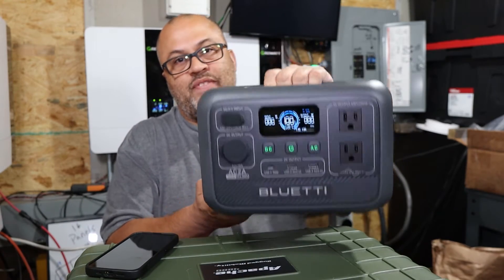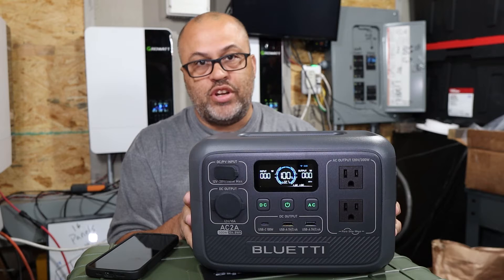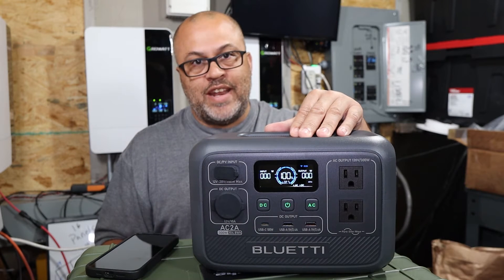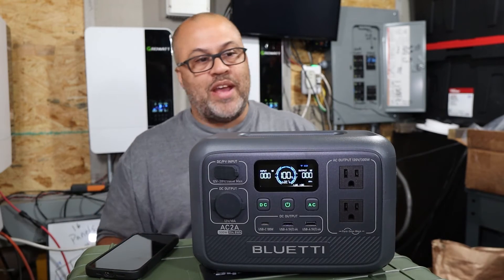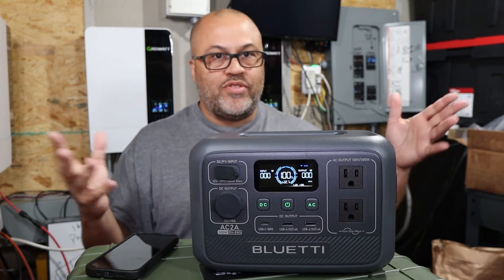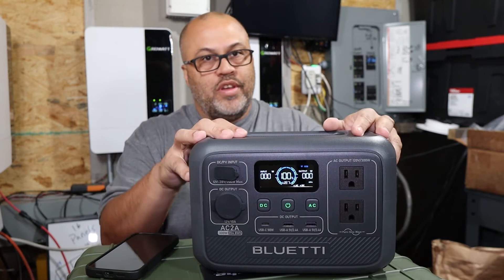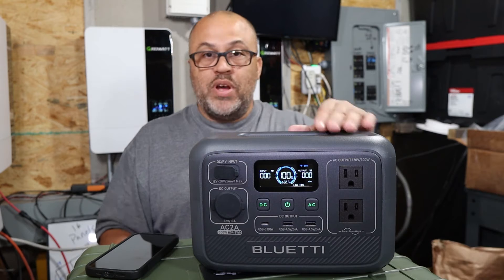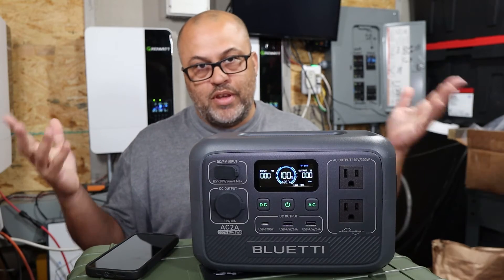This unit is very lightweight, so if you can't pick up a big heavy solar generator, this might be the option for you. Maybe you want to heat up an electric blanket for an hour before bed to warm it up when the power's out, or warm your sleeping bag in a tent while camping. The battery is only so big — you can't run it all night — but running a 40-watt blanket for an hour or two won't make much of a dent, and you'll still have plenty of charge left for your phone.